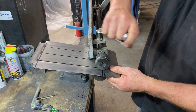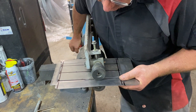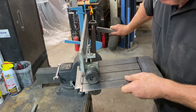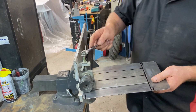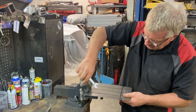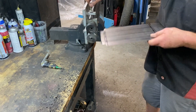Let's tighten that up a little more. Roll it back — the trick is going down the same groove, but with a little bit of practice you'll get it. There we go, that's one. That gives you a nice bead roll like that, which adds a huge amount of strength to the panel. Just do it again three more times.